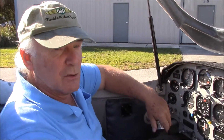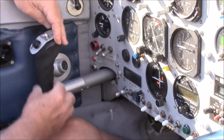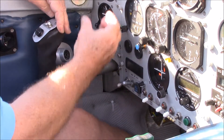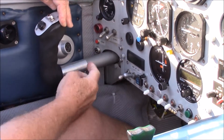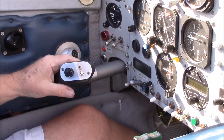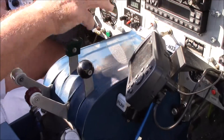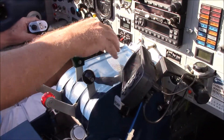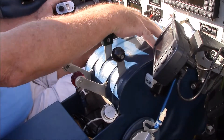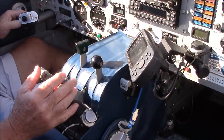So I did a lot of thinking about it. If you take a look at the yoke here, there's a gray anodized portion and then the yoke portion. The yoke normally slides in there, and I added a piece to both sides to extend the yoke further aft. The throttle quadrant was on the firewall — throttle, prop, mixture — with push-pull tubes, as in most smaller airplanes. I designed my own throttle quadrant, moved it further aft, and moved my yoke back.